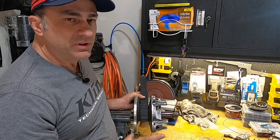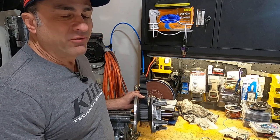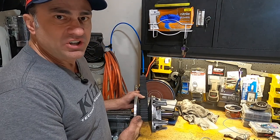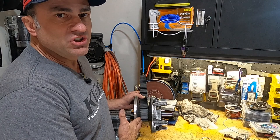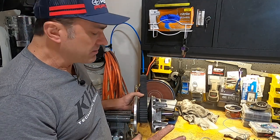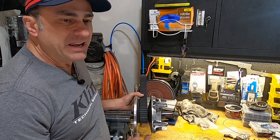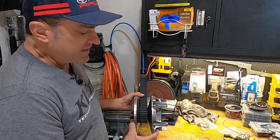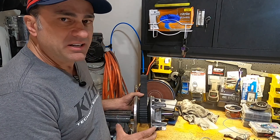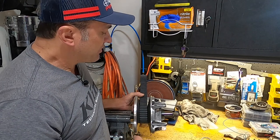So that's one symptom of a really loose belt. You might notice that one day you're riding your sled and all your clutch engagement is at 4,500 RPM instead of like 3,800 RPM like it was the week before. One of the things to check, your belt could be worn or your belt deflection could be out or both. Also, it can cause you to have kind of a rush start when the belt engages, because instead of engaging at 3,800 RPM, it might be engaging at 4,500 RPM or even 5,000 RPM, and that's going to grab the belt. Since the engine's spinning quicker when it grabs it, it's going to feel like your machine jerks a little bit when it engages. So those are a couple of things you may notice.